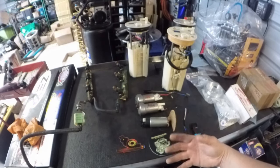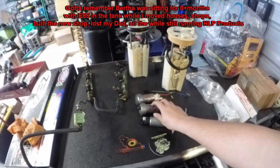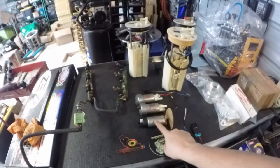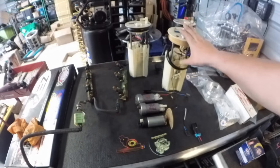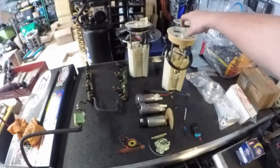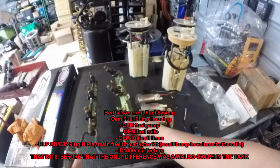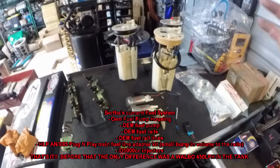I tried the 535 but had issues — both units were brand new, so I'm not sure if they were just bad from the factory. I put another OEM fuel pump housing with an OEM pump back in Bertha and she's running perfectly. She ran the stock fuel pump housing, stock fuel pump, stock fuel lines all the way to the stock fuel rail lines and stock fuel rails. The only upgrade on Bertha right now are ID1000 injectors — that's it.